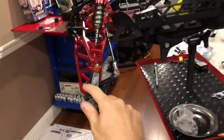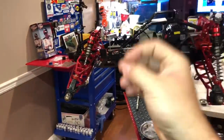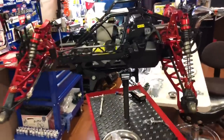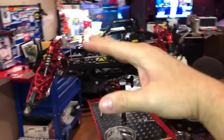Future-wise, I want to install the front brakes on this — we're going to put front brakes on this. I want to do jumps with this, so you're gonna need your front wheels to stop. Four-wheel drive cars control better in the air, no doubt about it, but this is two-wheel drive. If your front wheels stop, or if we can adjust them to stop sooner before the back, that should help straighten out your vehicle in the air once it's airborne. That's the main reason why I want to put front brakes on this.